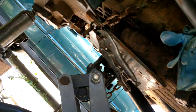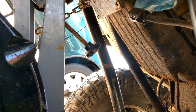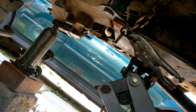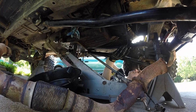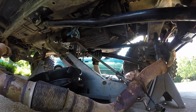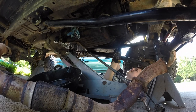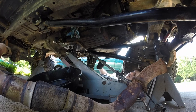Leave one bell housing bolt as the last to remove. The top bolts were already floating loose, which is great to know. The second I disengaged the last bolt, the whole transmission dropped about a quarter inch. The engagement pins are out and the transmission is basically disconnected. We've got a nice gap - transmission is free. Make sure you're out of the kill zone when that last bolt lets loose. The engine is supported, transmission jack is set up, and all hoses and wires are ready to come out.